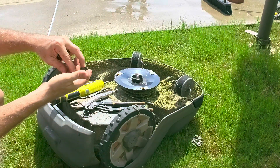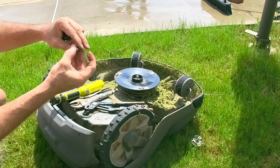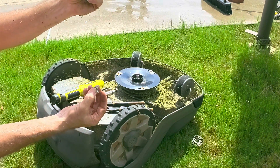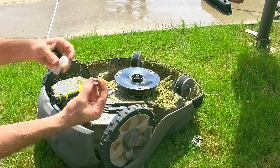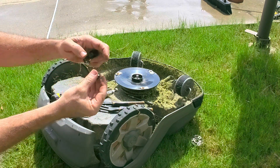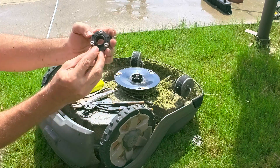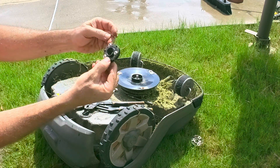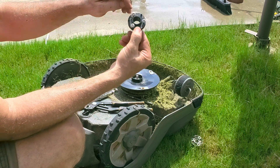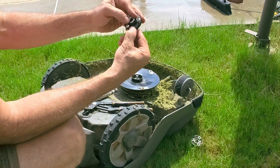Now these bearings — I will have the bearing number in the description. I bought a pack of eight bearings on Amazon for, I think, $10. So you need two bearings. There is a spacer in between. The bearings go inside this little housing. So essentially what you do: take a look at the orientation of the screws, how the friction disc goes in — one bearing first.